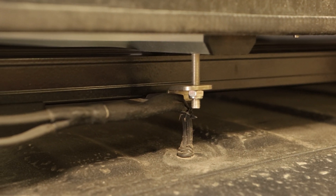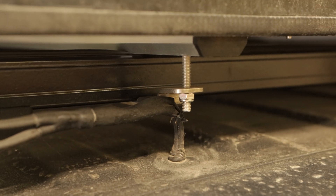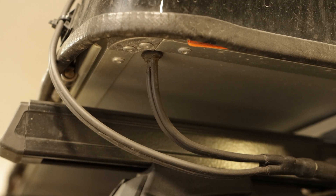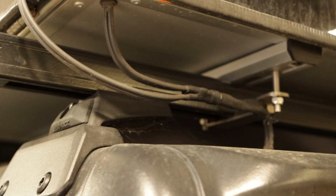Let me walk you through the setup. This is a DC USB, with lines running up the side of the hardtop. You can see it splits off — one line goes up to a hole with a grommet filled with RTV; never had it leak yet. That second line comes up, routes through zip-tied to the existing rear window defrost, with a mercury switch attached. The line then goes into the ABS tubing and out comes an LED light. Here's the roof where the grommet goes. This is actually three 12 gauge wires sharing a ground — they split off here. One power goes into the roof nest where we have an inverter as well as DC and USB charging ports. The other side goes directly up to the SunPower solar panel — it's 120 watts, attached with 3M double-sided tape. Never coming off; it's pretty solid.